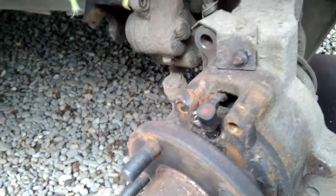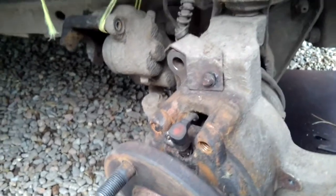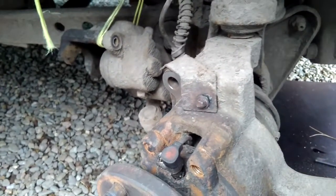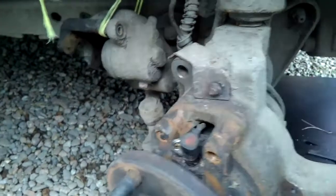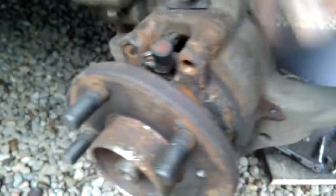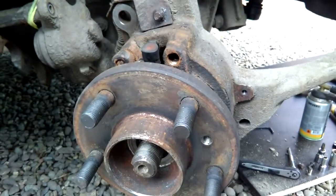Right, I'm now at the point where I'm removing the four bolts which hold the hub in place. I've taken one out here. You get new ones of these with the hub kit, with the new hub and bearing. I've loosened these ones off. I've turned the steering in the opposite direction in order to gain access to, if you can see it, that bolt there, and that is the lower one which comes out there. So it's two there, one there, and there's one on the other side as well. So I shall just remove this one,